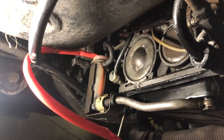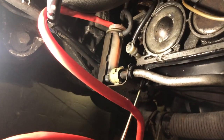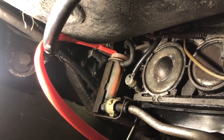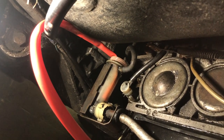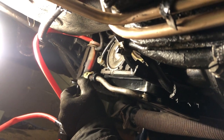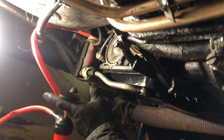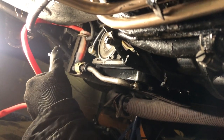I'm pumping the ATF fluid back up into the reservoir using one of these hand pumps — and I've got to say it's pretty useless. Probably 50 percent of what I pump in is air, which has to be bubbled out. I've had to remove the filter to get the pipe to sit in there neatly, which I don't really like doing, but I've been super careful and it's going in very slowly. Actually now that I've got the coupling set right, how the pipes connect up is pretty good. I just need to do it one-handed — you can see the level in the reservoir going up. I'll stop there, let it filter down through the pipe and into the pan, let it go down, and then fill it back up again.